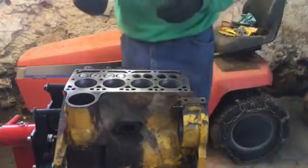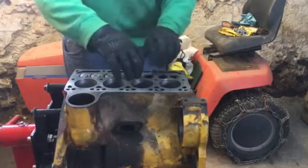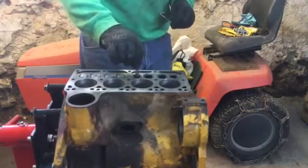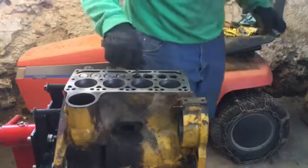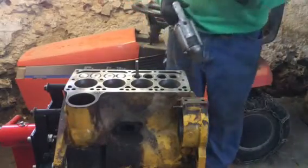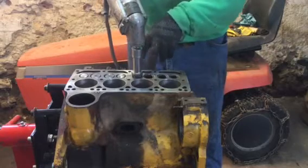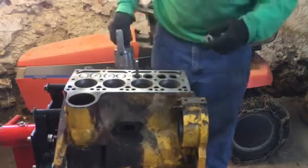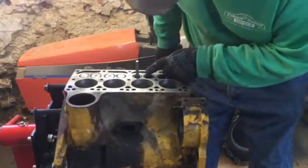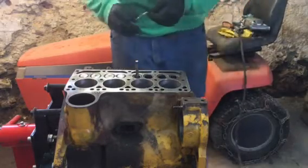I've got the correct pilot here that goes in the valve guide — this is the smallest one I have. This engine is a little bit smaller than a lot of the automotive engines I used to work on, but my equipment will just work. I've got the pilot installed there in the number two exhaust valve. I've got my stone on the arbor. Put it on the pilot there to guide it squarely over the valve seat and I don't have to take too much off this, just a little bit. And check it out — I can still see a few of the pits there.